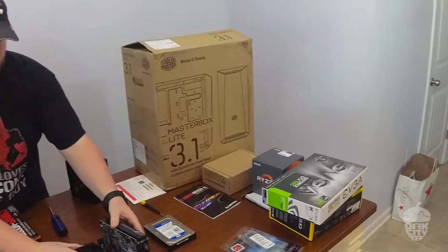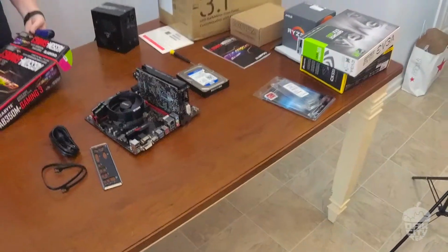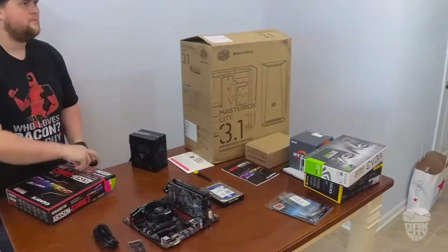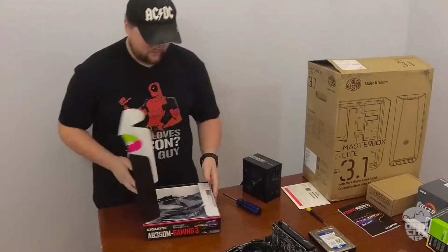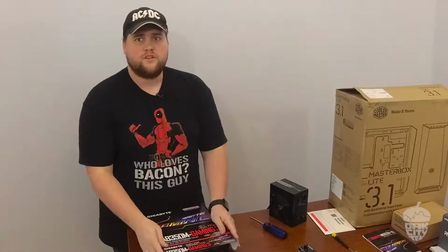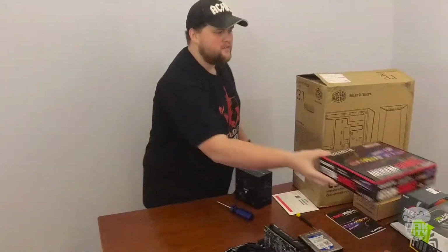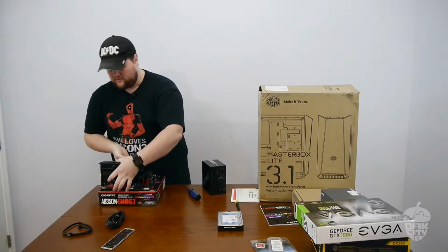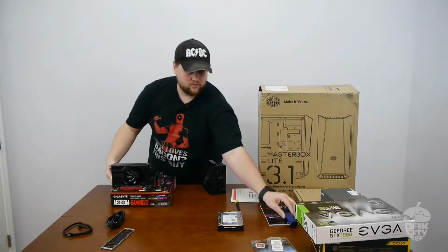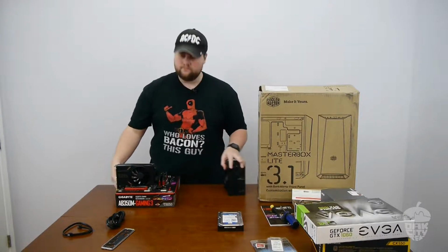So it just sits right underneath the graphics card, huh? Yeah, the M2. That's why I love M2 so much. There's no power cable to it. Yeah. And that's a SATA version M2 drive, which means there probably is a SATA version of that drive that's identical to it. It's just a SATA drive, you know. But for the price, you're not paying any more for that SATA version than you would for the M2 SATA. Now NVMe is where you get, you know, more expensive.